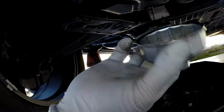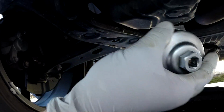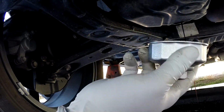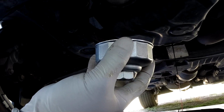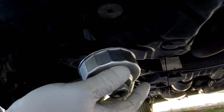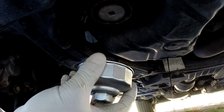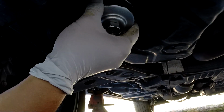After you drain your oil, you plug the plug back up, and then don't forget to take the filters out. You need one of this socket right here, and you can purchase from Toyota. I'm not sure how much, but right around $20, something like that. Okay, and this is designed to open all Toyota, Lexus. Okay, this is the same. Lexus and Toyota basically is a Toyota. Upper class is Lexus and lower class is Toyota. So engine very much same one. Okay, and that go right here.